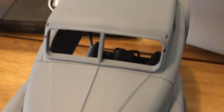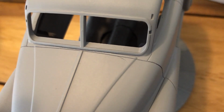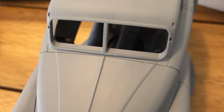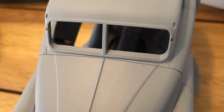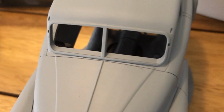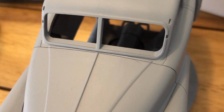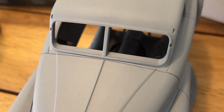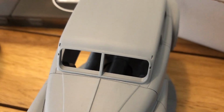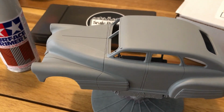But there are times where you are gonna run into problems. If you can see there on top of the hood, I did scratch it there. It's easy to correct. You have a couple options. You can either add a little amount of glue and just sand it down. But if not, you can deepen down your line and then just sand it down, either with a 240 grit or even a 120 grit. Really lightly though, don't go too heavy on it. But yeah, those are all little minor things that need to be corrected.